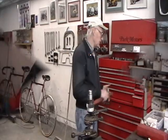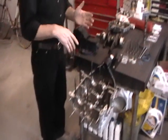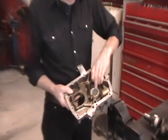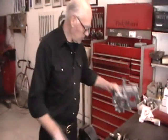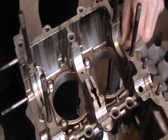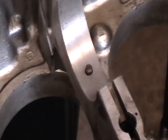Now our crankshaft is all prepared and ready to go in the case. We put the crankshaft into the crankshaft housing, which consists of three pieces: this one, another one, and the third piece that goes on the end. The third piece holds the last bearing of the crankshaft, the oil pump, fuel pump, and distributor drive — but that comes later. We're using this side because it has the locating pins, and these pins locate the bearings. They cannot protrude any more than seven millimeters, otherwise it interferes with the clearance of the bearing.